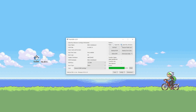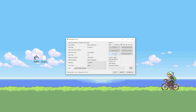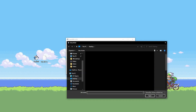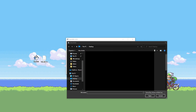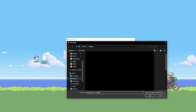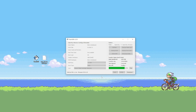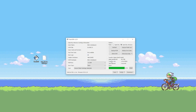Once that's open, switch it over to the Game Boy Advance mode and click Write ROM. Select Try Generic Type and then write the ROM file that I'll have linked in the description. Once it's finished, select OK, and then disconnect the GBX cart from your computer.